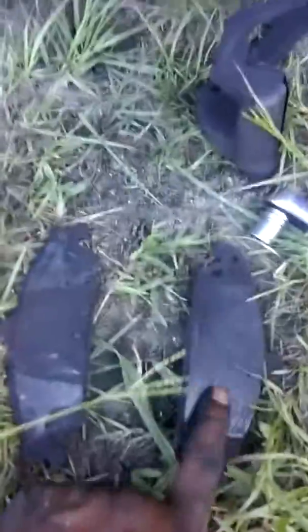All right, and then take it back off the C-clamp and put your brake pad where it came off at. For starters, this was your first brake pad, and this was the one that came in the back. I think I should have had shop towels because I didn't want that red stuff on the rotor. And to keep the rotor still, all you've got to do is put one of your lug nuts on, like so. Now, we're going to simply put the bracket back on with our two bolts.